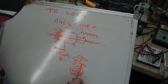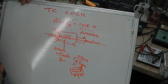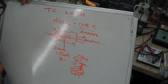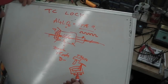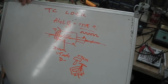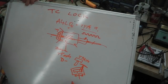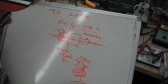The T-shifter will need a micro switch to tell it's in the drive position, okay? Because we don't have that. Although I think the later gearbox has a multi-switch on the side of the gearbox selector housing, outside the box. I might look at a scrapyard to get one of them. If not, we've got to build a micro switch on position D. We need that for the cruise anyway, because cruise also only comes on in position D. So we're going to have a micro switch here.